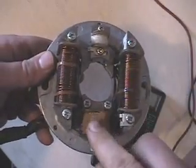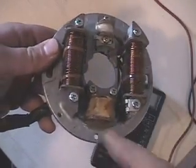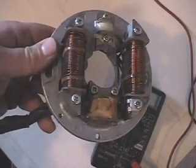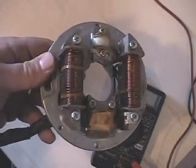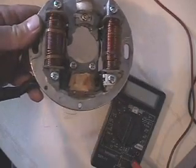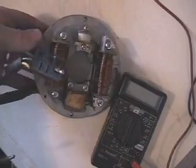We've got a low speed and a high speed. Here's our low speed and here's our very small high speed. The special thing about the low speed is that it is basically 1,200 ohms — sometimes they'll measure higher, like 1,270 or 1,280 — but we just say 1,200 ohms. No other stator that Kat made tests that high for ohms.